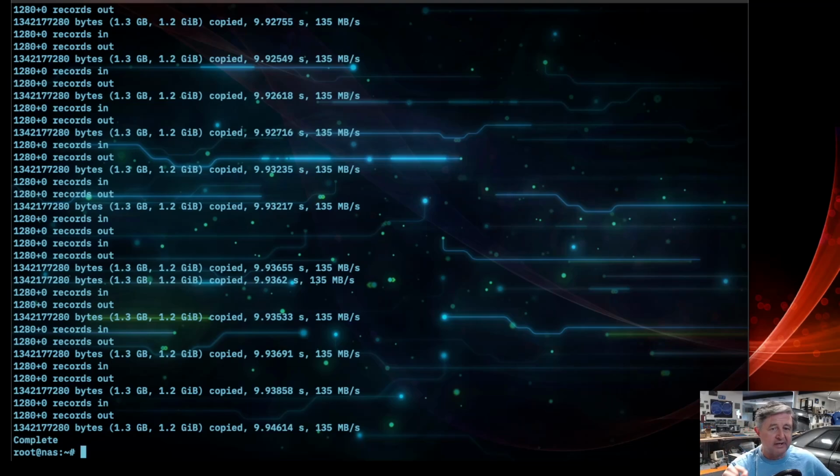And so the takeaway here, and I mentioned this in the previous video, is that if you have a JBOD that has 16 disks or 24 disks or 32 disks or 36 disks, and it has a single SAS 4-channel interface, that 4-channel 6 gig SAS interface with reasonably performant hard drives is really good for maybe 8 to 12 disks before you're oversubscribed. And sure enough, at 16, we're oversubscribed by quite a bit, almost 50%. And so it's a good indication of what the max speed is. So this gives us this ballpark number that at most we're going to get 135 megabytes per drive if they're all going at the same time.